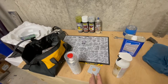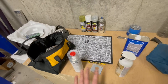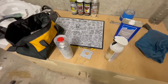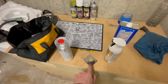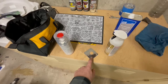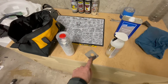The drying instructions say apply a second coat within one hour or after 48 hours. I did the sample last night — it's been over an hour but not two days — so I don't want to clear it yet. The plan is to paint all the piping, then paint the other side of this sample at the same time, and after about 30 minutes put the clear on the sample and do two coats on everything.